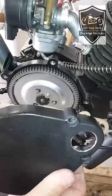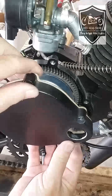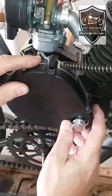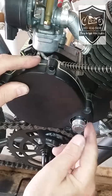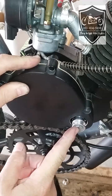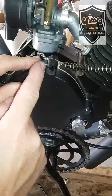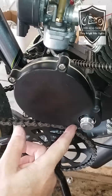Now you can put your side cover back on — see how this will work. Your pulley sticks out just far enough. It's going to give the belt about an eighth inch of clearance between the case and the edge of the belt. That's all you want — keep this as low profile as possible. So you've got a better chance of your stock pedal cranks being able to come around and clear this, but wide pedal cranks would definitely make this a lot easier. I'm putting three out of the five screws in and leaving the two front ones out.